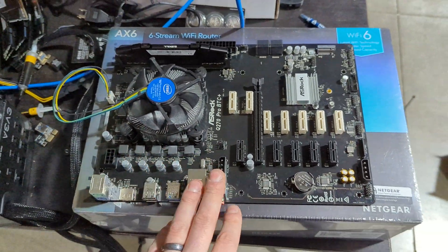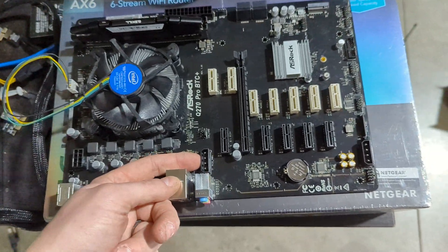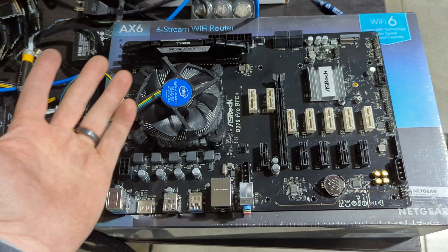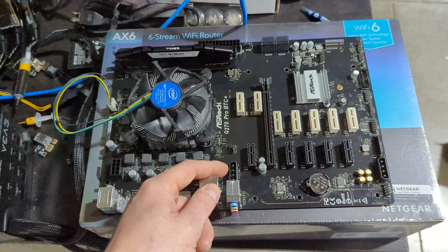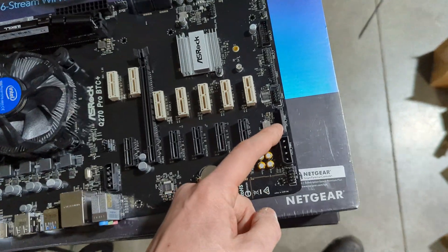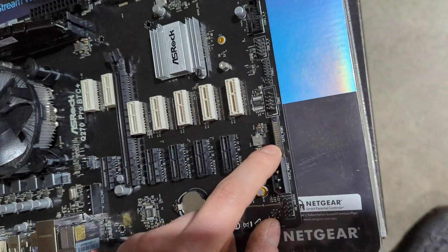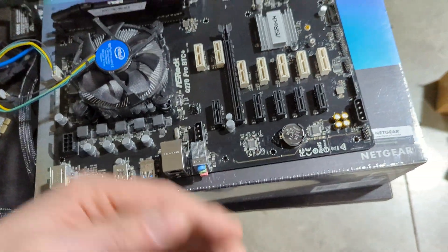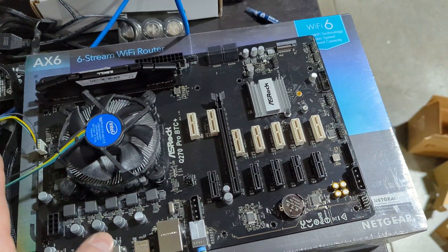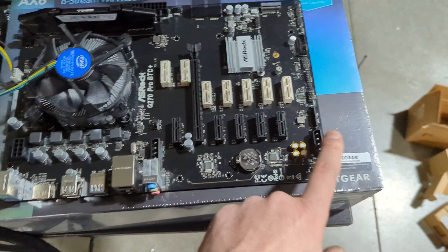We run 3080s, sometimes 3090s, but usually just 3080s — it runs them just fine. In terms of power, this motherboard also requires extra power. You notice on various motherboards that have 10, 12, 13, or 14 GPUs loaded on it, it requires more power for signals or whatever. The riser is where the GPU power is coming from, but it still requires more power for the motherboard. The power it requires is one molex here, one molex here, and then a SATA here. Since we're running 1500W server-grade PSUs, it's a little different setup, but it works. So we've got those three additional power connections coming in, plus your CPU plug right here.